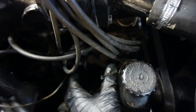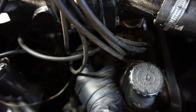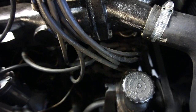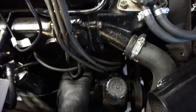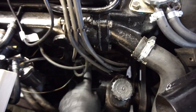You can do that with the engine running if you want, or with it off. So let's say this was off a few degrees — I could loosen that, advance it just a tiny bit, tighten it up, start up the engine, and check everything in. If you're not comfortable putting your hand down there with all the belts and things rotating, it can also be done with a helper. Your helper looks down at the timing marks while you turn the distributor, and they can let you know when it's perfect so you can tighten it down.